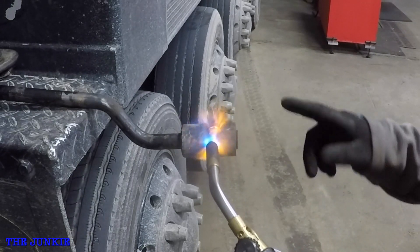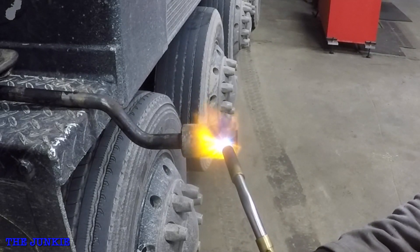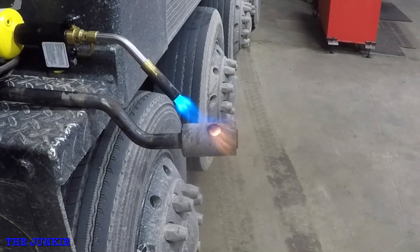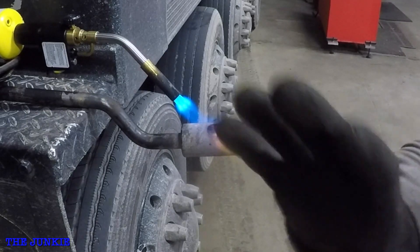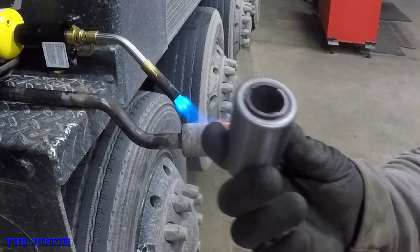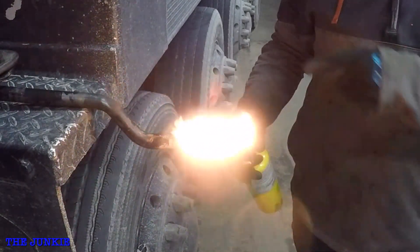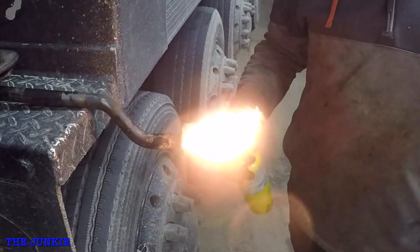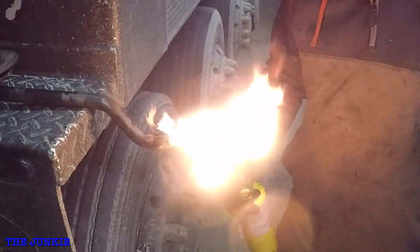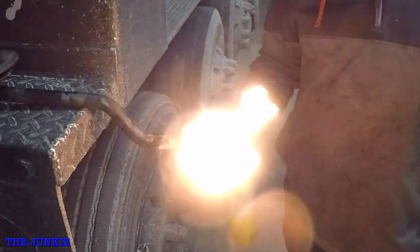I forgot to do one thing — I've got to go put that other part in the freezer. You want to put this in the freezer just so you can slide it in a little bit easier. What you don't want to do — I did this the first time — is heat this up then drop this in there, because it melts all the rubber out of it. We're pretty much on fire and we're pushing out all this rubber. I really need a set of torches but these map gas things work pretty good.